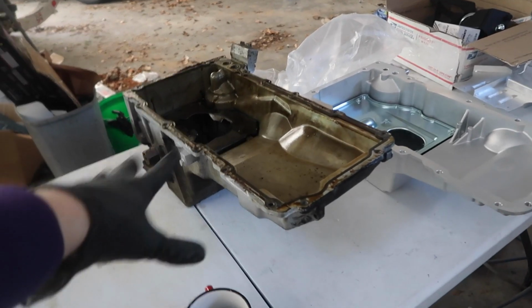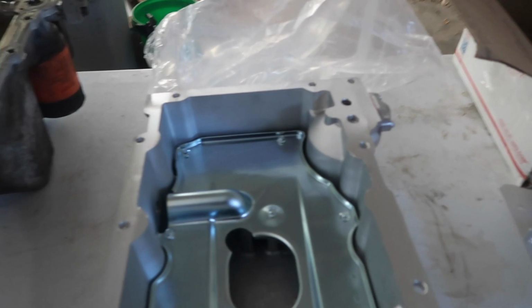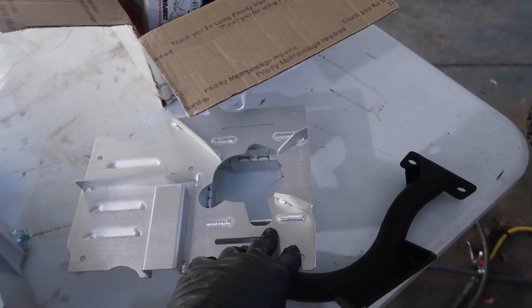So here's our truck pan versus our Camaro pan. They're a lot smaller. So that's good. One thing I like about the Ronin kit is they give you all these instructions on what to do and suggestions on things you need. We need an oil baffle pan because LSs love to oil starve. So Ronin suggests using this one from Improved Racing.